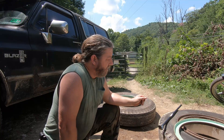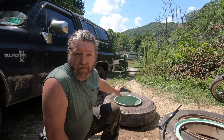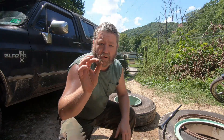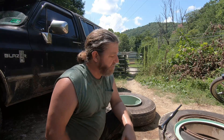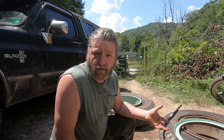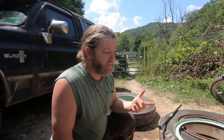There are no valve cores in these tires right now. The very first thing you want to do on a wheel like this before you even take it off of the bus — before you dismount it — is you want to remove the valve core out of your tires. I just keep one of these little valve core removers on one of my valve caps so you can just take it, remove the valve core, and throw it in your pocket so you don't lose it. If there's no air in these tires, they're 100% safe. There's nothing going on with the tires that can possibly hurt you when there's no air in there. We'll go over how to reassemble them and how to put air in them safely after I get the brakes fixed.